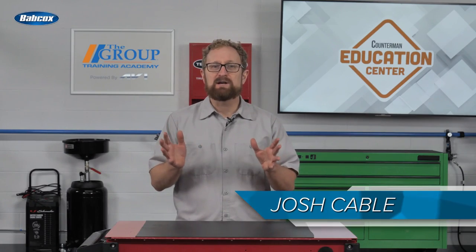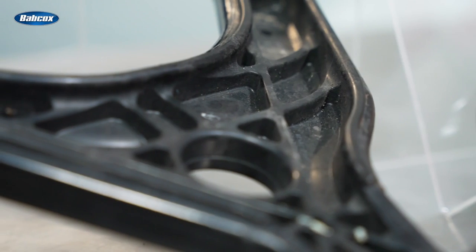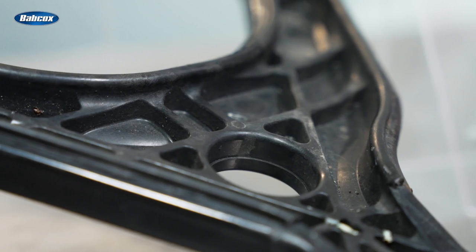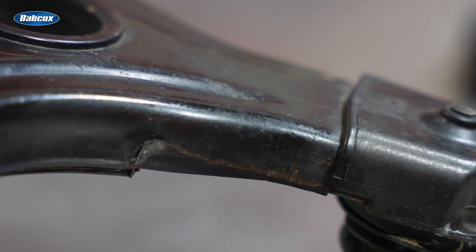Still, even the most beloved brands have their quirks. In the case of Tesla, one of these quirks is the upper control arm in Models X, Y, and 3. This Tesla OE control arm boasts a state-of-the-art design made of a hybrid steel and composite polymer called FRP, which stands for fiber-reinforced plastic. While this is a light and strong control arm, its strength could be questionable, and the method of attaching the ball joint leads to a noticeable seam. These ball joints have been known to creak and squeak, and there have been documented instances of the ball studs separating from its socket in the joint.